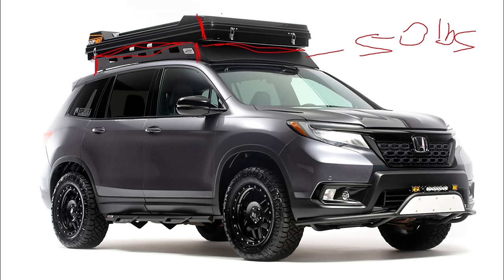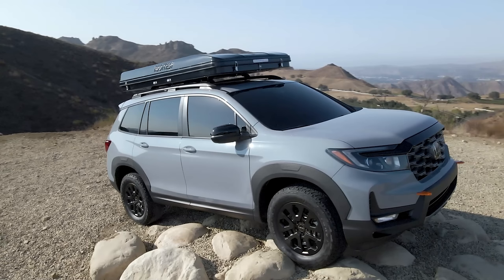These bumpers are typically attached to the radiator support beam in an all-wheel drive vehicle, which means if you take a hit it's going to be really bad for that radiator — take enough hits and your vehicle's done. Next up are these side steps that look like rock sliders but are the exact opposite — they're effectively rock catchers because of the brackets that angle down, literally pointing down to catch on a rock, centered right on the break-over angle. Stuff like this could get you into trouble on the trails. All three of those issues were addressed in the build that I helped with.